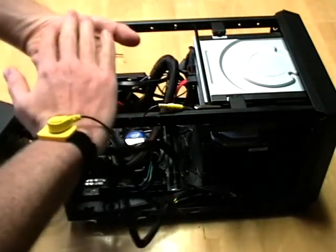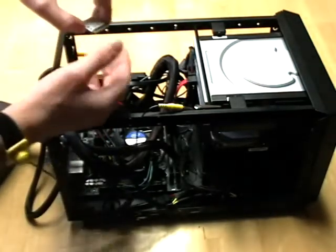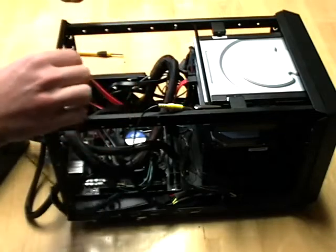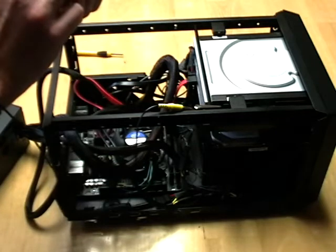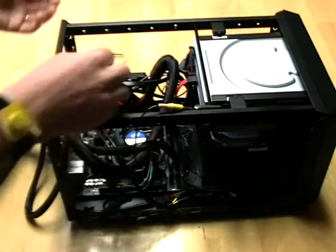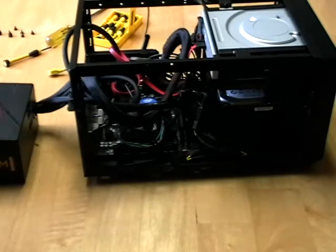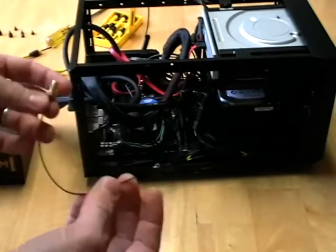Built into the motherboard there's a little plastic casing that the new wireless card is going to plug into — this piece right here that sticks out. That's what's going to plug into the new location. Then the last bit is that there are two little plugs that go onto the wireless card that you have to free up.